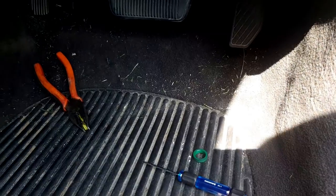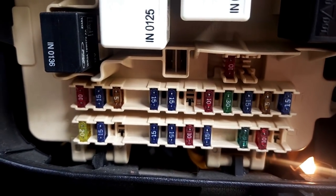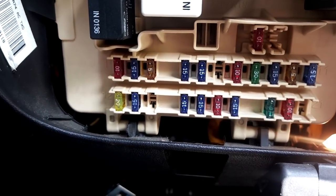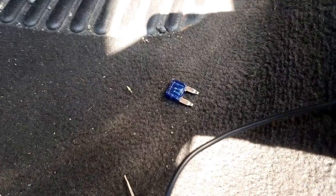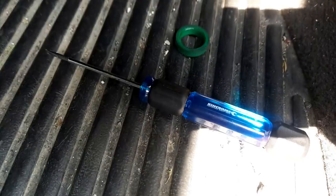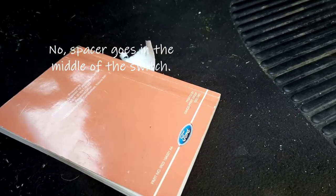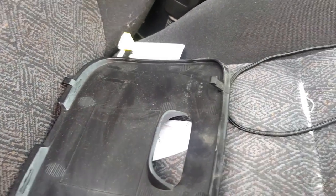I'm not going to try and video the fitting because I've got to get myself in there - there is no room for the camera as well. I managed to get the old one out and the new one is currently wired up for testing, and at first it wasn't working - that's when we discovered that the fuse was blown. I've nicked the spare fuse off the board so everything is now functioning. It could be that I didn't have to replace the brake light switch, but something had made that fuse blow and it could have been the switch. I'm very glad the manual is here because the back of the fuse box contains no clues whatsoever - most manufacturers would put the fuse diagram on the back of the box but this has absolutely nothing.